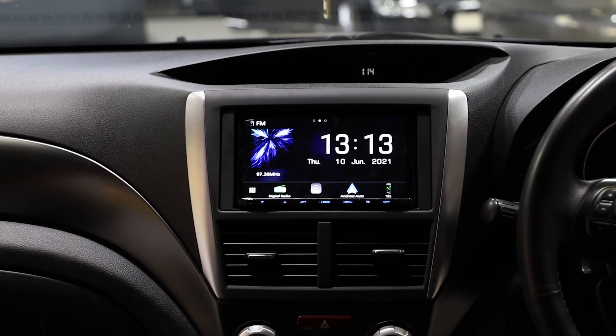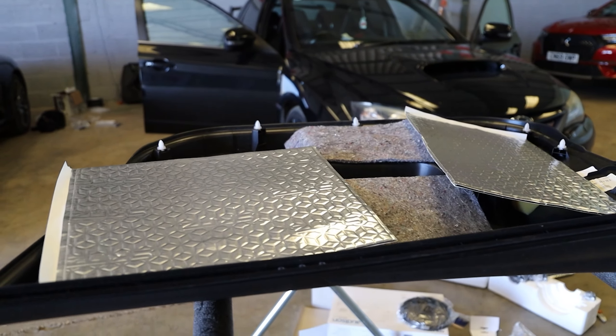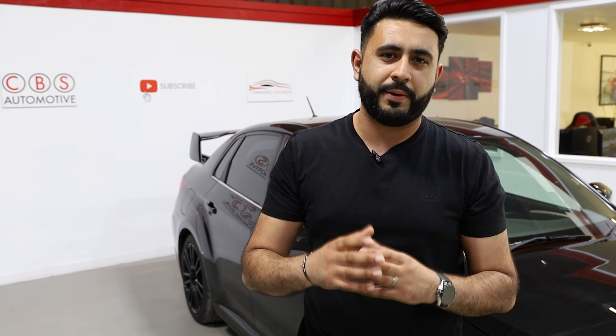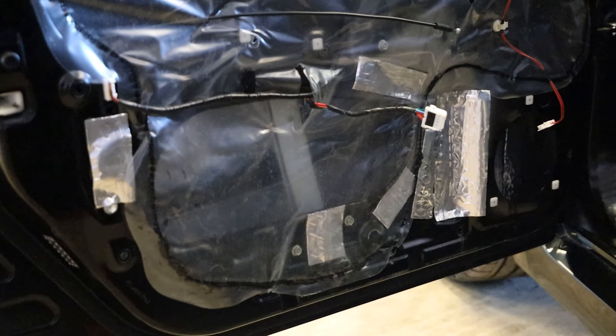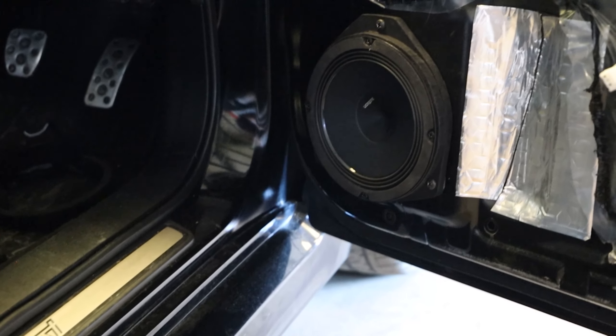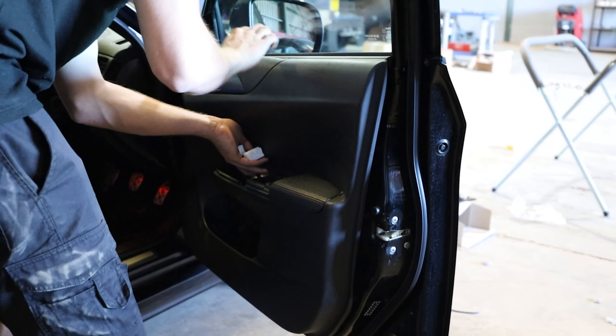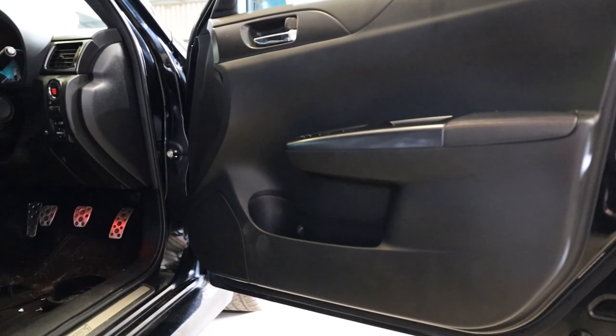We've added loads of functionality but also upgraded the sound in the vehicle, which the customer wants to do in stages. We've gone for 13 sheets of Skin soundproofing and the Audison Prima upgrade. Skin soundproofing — what actually is it? It's a bit bigger than an A4 page as a sheet and it's a three-mil layer. It does three key things: first, it reduces rattles and resonations in the factory door; it also builds a far stickier environment for the new sound system to work in; and it reduces unwanted road noise.